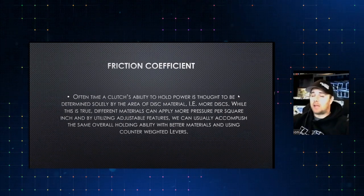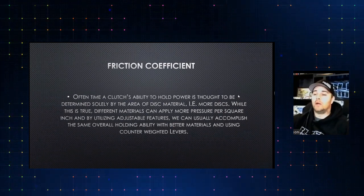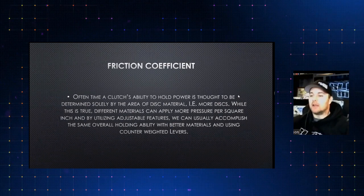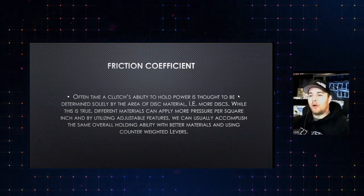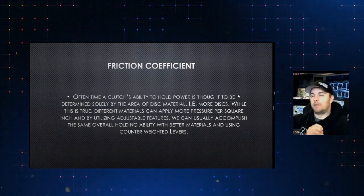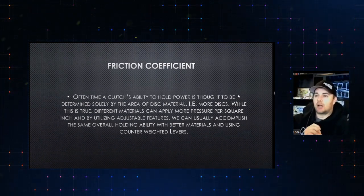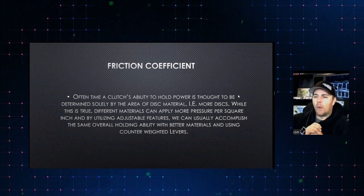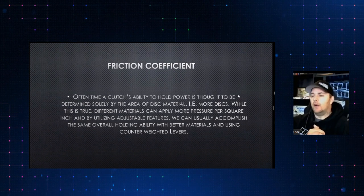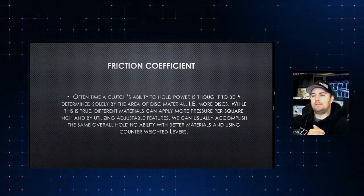We have a lot of compounds available to us that we work with that are somewhere in between. It's not just one or the other. So we don't have to live there, although those are the three that most people are the most familiar with. Most door cars, single disc stuff for the most part, aside from a lot of our stock eliminator type cars or lower horsepower to weight ratio cars, some of those we have special compounds that we put into that are more between a 5050 and a 5191.